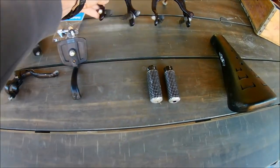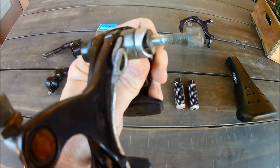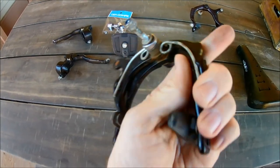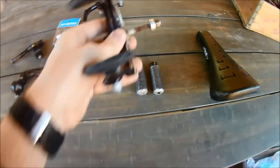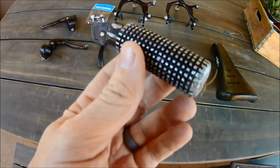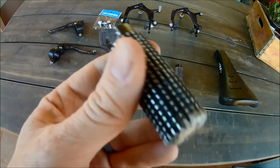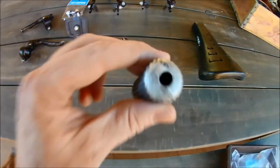The paint on both the front and rear calipers was looking pretty good, however all the hardware was rusty and had some corrosion. So I'm going to disassemble them and drop the hardware in the paint stripper in hopes that at the very least it will take care of the rust. Much like the brake levers, the pegs had seen their share of abuse. I've never actually soaked aluminum in molasses before, so this will be a little bit of an experiment, but I assume everything will work out fine.